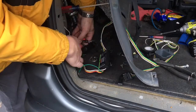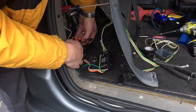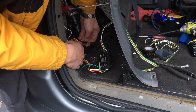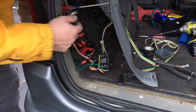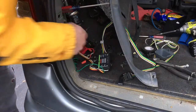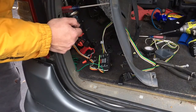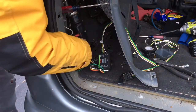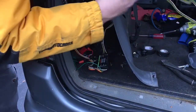What I've done is — there's a plug here which would have originally been for the lighting kit, and there's also another little plug there which I'm not really sure what that is. Basically, yank that sucker out and snip those wires off close to the plug. If you want to use the plug later, you may want to snip it farther back. I couldn't find an OEM one — maybe Mercedes carries it, but my guess is it's pretty expensive. That's how you do it. Just run your wires out through the side here — and there you have it, four flat.